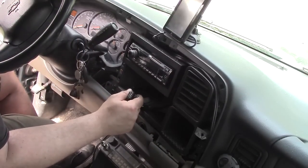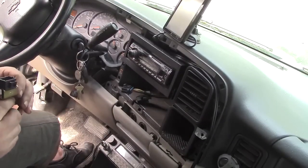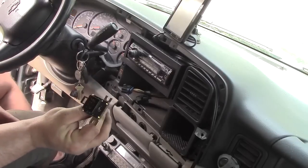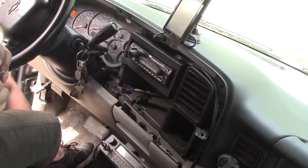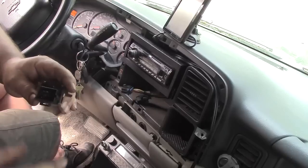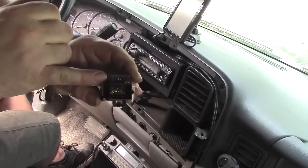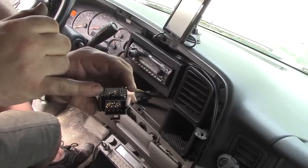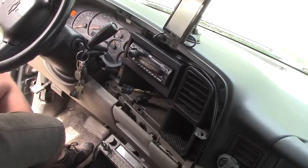They look good. I don't see any sparking, arcing, or melting. And the connections on the switch are actually nice and shiny, so I don't have a problem with electrical connections. I have a problem with the switch. And I do see something here. I don't know if that's epoxy, like covering something up, but I see a little melty bit there, right on the top of that connector. That probably isn't good. Now, let's go see what we see.